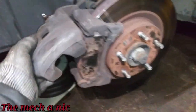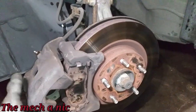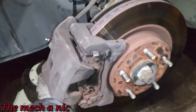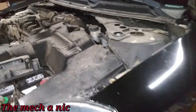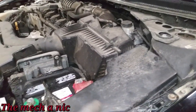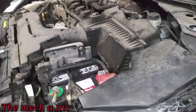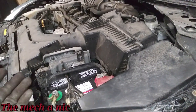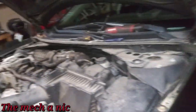So just as I suspected — two brake calipers going bad at the exact same time is not likely. There's nothing wrong at the actual brakes themselves. New pads and rotors are needed since they've been overheating, but that's not what's causing the problem. There is a separate reason why brake pressure is being applied to the front brakes only. Could it be the ABS module? Another thing to note: they did not have this issue before the battery was replaced. They put the new battery in and suddenly the front brakes were locked up.